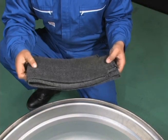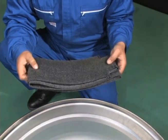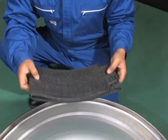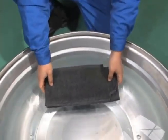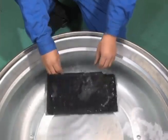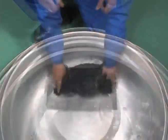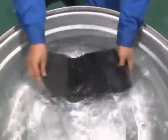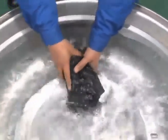The air filter must be cleaned at least once every two months. Soak the filter for two to three hours in lukewarm water in which a neutralizing cleaning agent has been dissolved. Then gently wash the filter by hand.